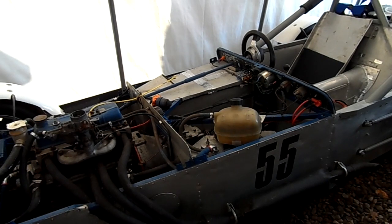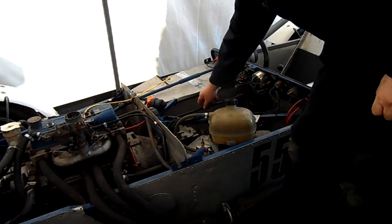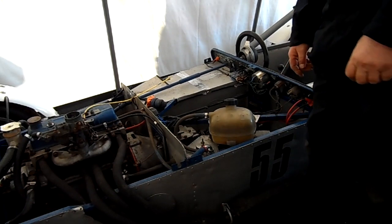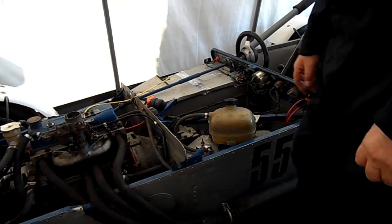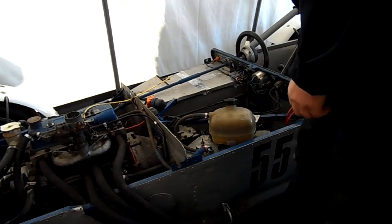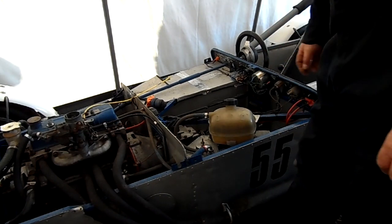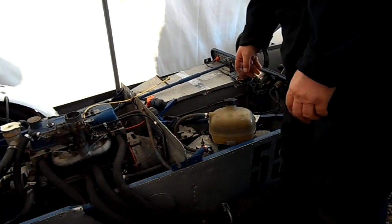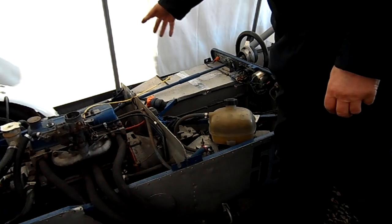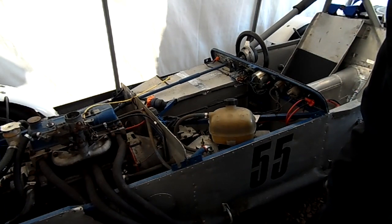This is the installation in the Geoffrey. The gearbox is sitting in here and I've got the extension out to the cockpit with the gear lever. It can come out with the engine in situ — it just takes a bit of jiggling and rotating through the hole. But I've got to take a few other bits off to give me clearance, including the prop shaft, some wiring, and the clutch actuating lever, which involves taking out part of the pedal assembly. There's an awful lot of screws to take out.